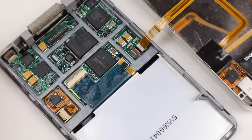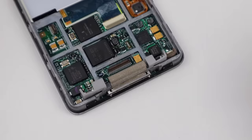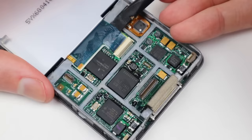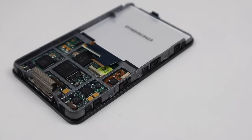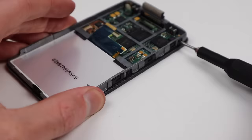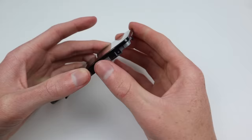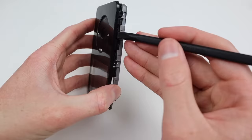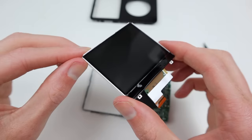Powering the device back down, I disconnect the 3000mAh battery and get it out of the way. I'm going to disassemble the rest of the iPod to access the LCD and change the faceplate to a custom clear plastic one. Once you've removed the back panel, the rest of the internals are quite modular and easy to repair — something that definitely can't be said about the iPod Touch. The iPod Classic offers many upgrade options: storage is easily replaceable, the battery is upgradable, and you can even add custom parts to customize the exterior.